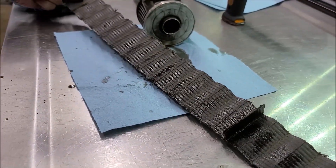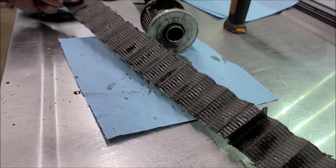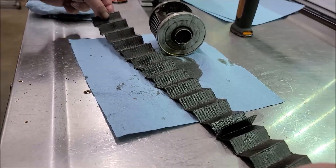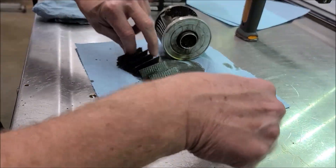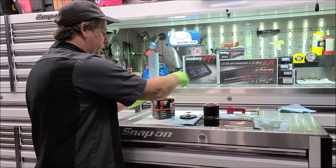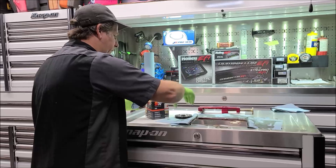And this is actually what you want to see — no metal, no foreign objects at all. If there was bearing material you would definitely see it sparkly in each one of these grooves. We're simply going to put it back in the old box just the way it came apart, so that if the customer wants to see their filter we can show it to them.